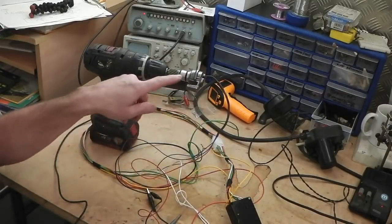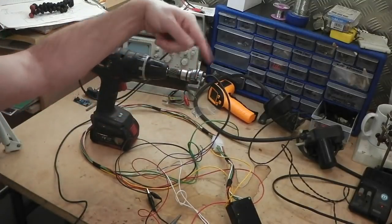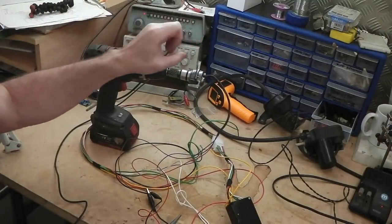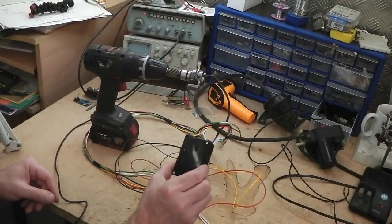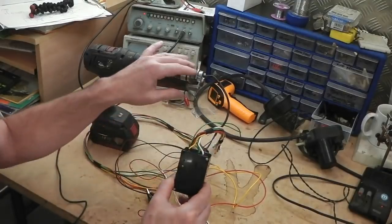That is now connected in, it's got 12 volts to it, it's got ground to it, and it's going to start putting out pulses. Let's call them 12 volt pulses, they're actually 9, 12, 12, 12, faster and faster and faster. This is going to monitor it. At the moment, safety is on, there's no lockup present because we're not running our road speed.